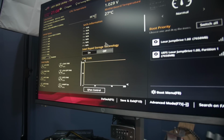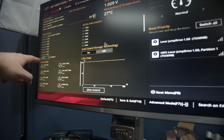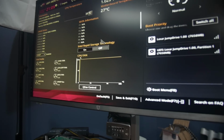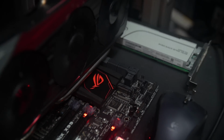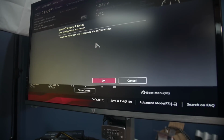Why not? Well, because the UEFI, the software on the motherboard, doesn't support the new processor, even though it's physically compatible. So what you have to do is update the UEFI. Well, on some boards, when you're in that situation, you have to put an older CPU in, update the UEFI, and then you can swap in a new CPU. Hey, no problem for me. But most people don't have multiple generations of CPU lying around, especially ones that were so close together.